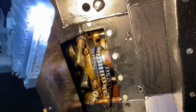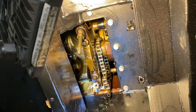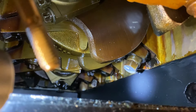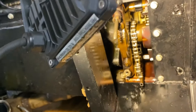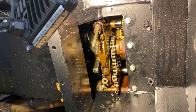As you can see in the oil pan, we have a bolt and a nut with a nut inside — those two have to switch places, that one was there and vice versa, and that's all you need to do there. It's a return line from the oil pump in the stock location. We've made M8 threads and put in a blanking nut, and we've cut the bolt down so it's only a screw to hold down the block bracing. So nothing bad happened to the engine — these are just small modifications.